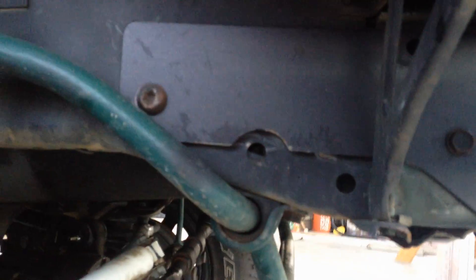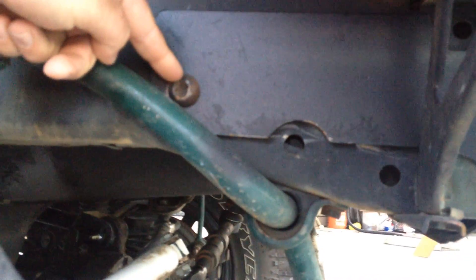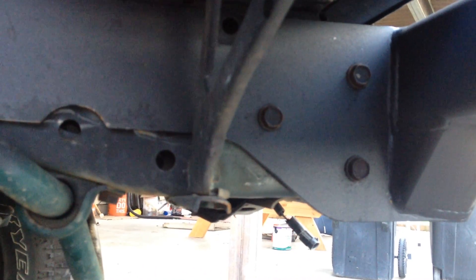The important thing when building your bumper is the tie-ins. You can see those three bolts there, and then further back I have one more right here. My '96 Cherokee Classic came with a package that had extraction hooks, so my brackets came all the way to the back. Most Cherokees just have a little janky bracket that bolts with three bolts. For strength reasons, because it's unibody, you want to take the tie-in as far back as possible. I'm planning to add another series of holes when I get my winch on. It's quarter plate - I made a cardboard template, cut it out, and welded it on. It's plenty strong.